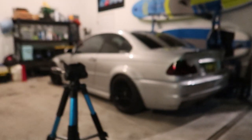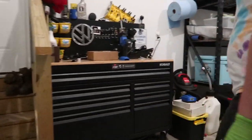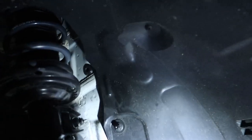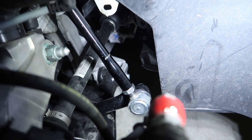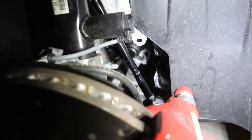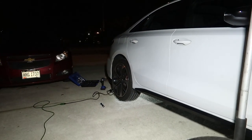It'll probably be a week or two or three until we get the arms on, but we'll just see what the sway bar and end links do. So this is about how much preload I wound up with - and they're in there. Now I'm just going to tighten down the lock nuts and we're good to go. Now I get to move on to the rear - do studs, pull out the old sway bar, old end links, and do it all over again.